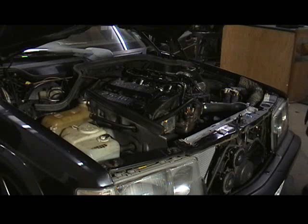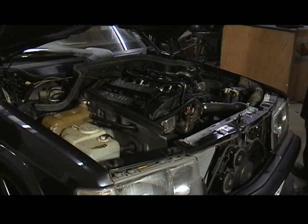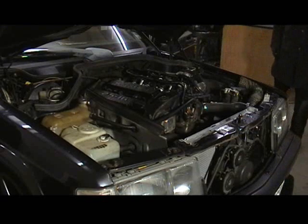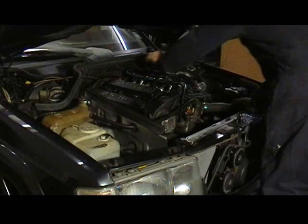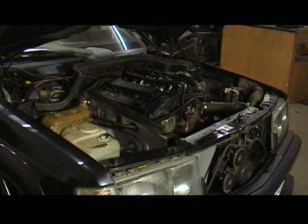That white band's rattling in there. What happens if you keep priming it? More fuel — yeah, that's going to need more fuel. Increase the starting fuel, the cranking will prime. So the throttle cable's over-adjusted, hence the fast idle. And the fueling's a bit on the rich side at about 11.5 to 1, hence the slight misfire.